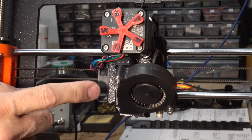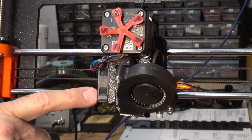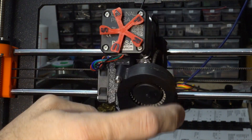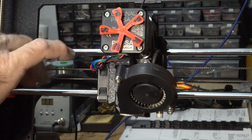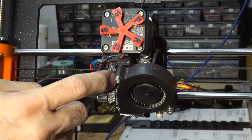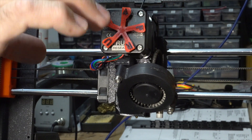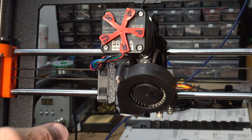So it's not that difficult to do some work on the Prusa. You remove the two screws — the one below is longer than the one up top. You remove those two and put the fan away, maybe put some glue to hold the cables, then remove the shroud with its screw. After that you have two screws just underneath that hold the cap, and then two screws on the back for the motor. Remove those two screws, gently remove the motor, and you have access to the whole hot end.